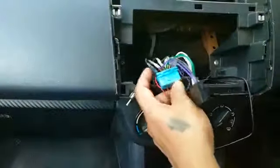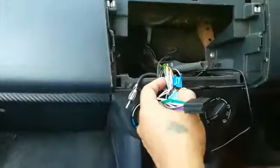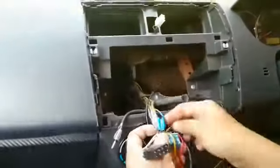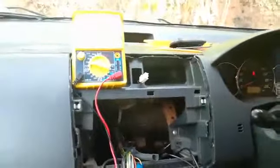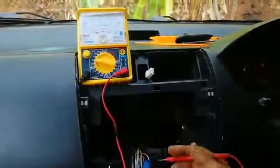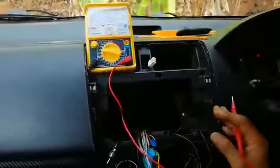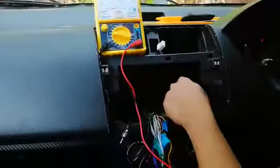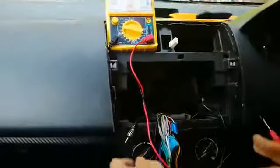Next, you need to connect the power. You can check the power with a multimeter without turning on the car. Unplug the ignition key — one of the power lines will always be on for memory. Put the negative line of the multimeter to any metal part in the car body for grounding, and use the red probe to find the power lines.